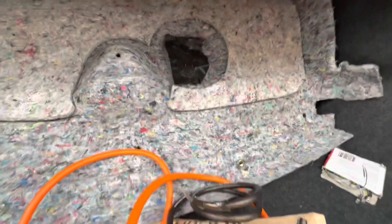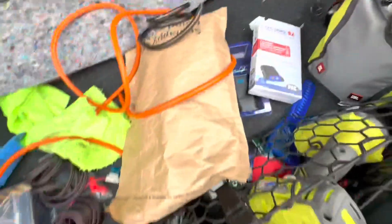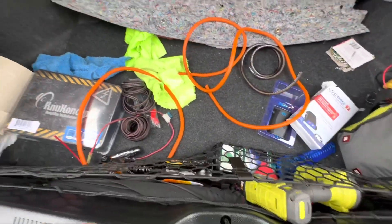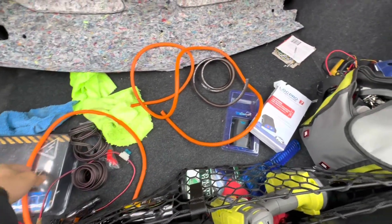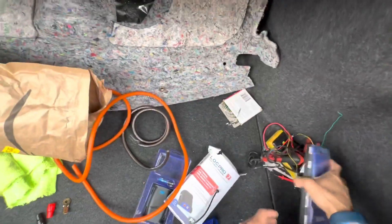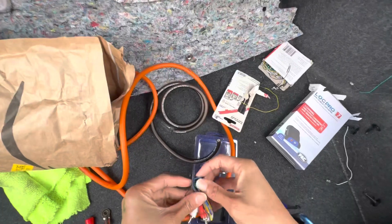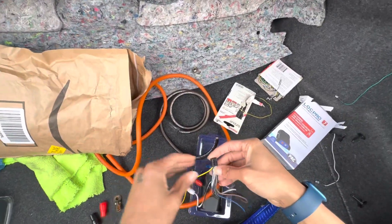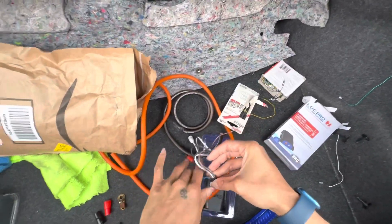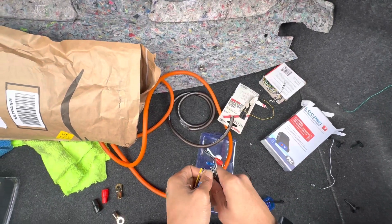Like I said, I already got the wire tapped. I'm gonna tap the speaker wires into the LOC. I didn't know they had plug-ins for a sub, so maybe a future sub right there, maybe not. I'm gonna get everything prepared, get the speakers in, and do a test. Quick and easy with LOCs — that's the power wire, ground, and turn-on — the three main wires you need. The mute wire I don't need, gonna cut that off. I'll just cut these and use these for later, they do come in clutch.